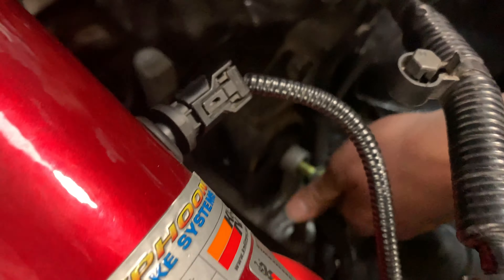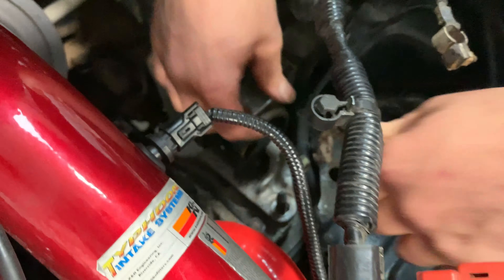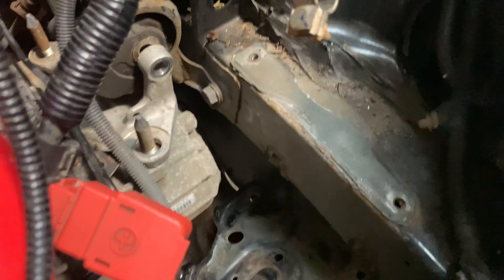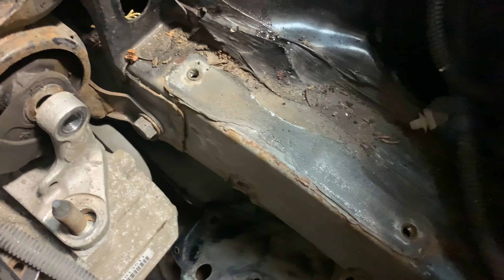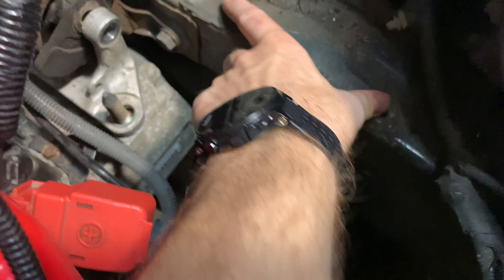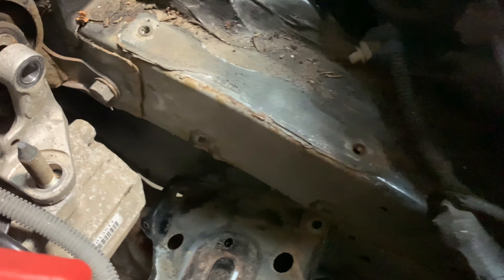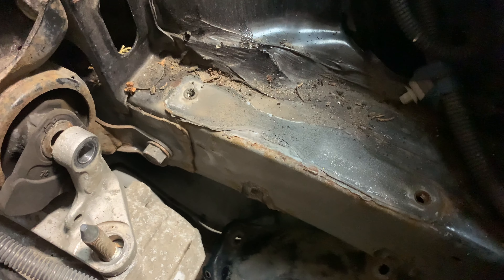Battery out just to make the space for that bolt, which is a 16mm bolt. That should give enough space for that to come out. You also get to see how to unbolt the battery tray, which is helpful for a future video. When taking the battery tray off - which gives access to that bolt - it's actually stuck on with seam sealer and four bolts, two underneath and two on top. It almost looked like it was spot welded on at first, but it wasn't - just sealer.